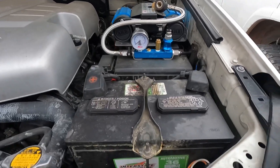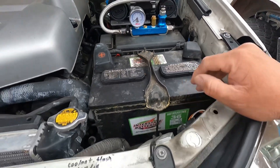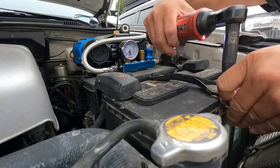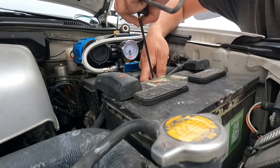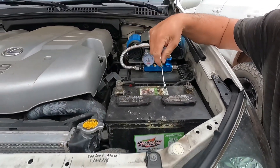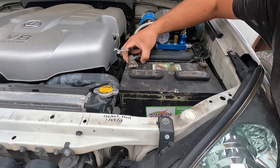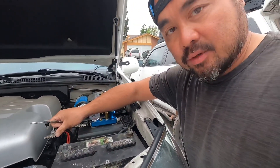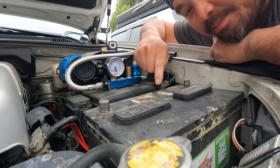So the first thing I'm going to do is take this old battery out, put it in the new battery tray along with the new battery. It looks like the kit doesn't come with new battery terminals for the main battery, so we're going to keep these on — just take them off this old battery, put it to the side, and then plug the new battery using those old terminals. The hardest part is lifting this big battery out of here.